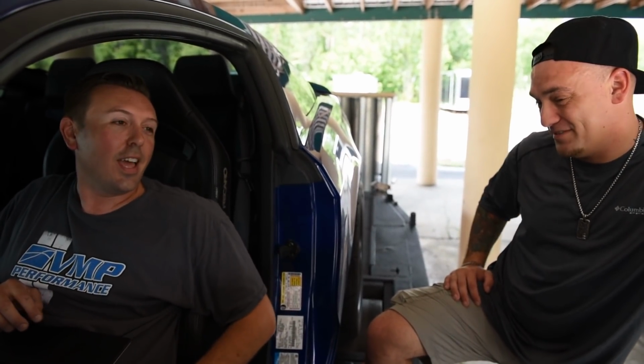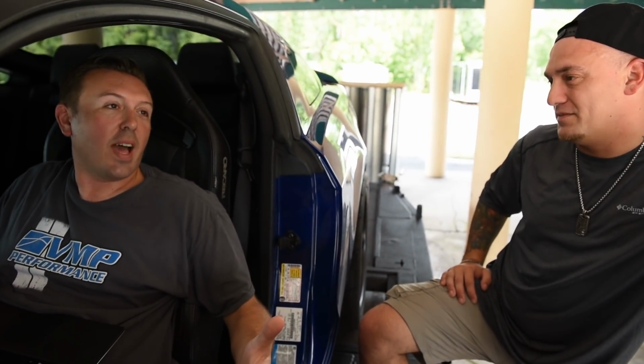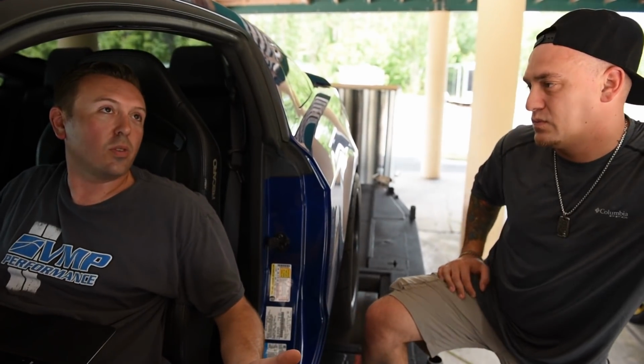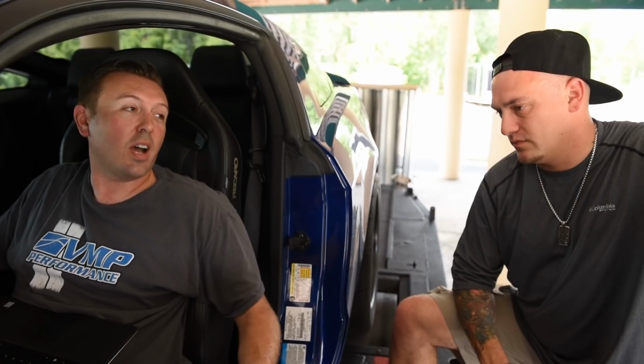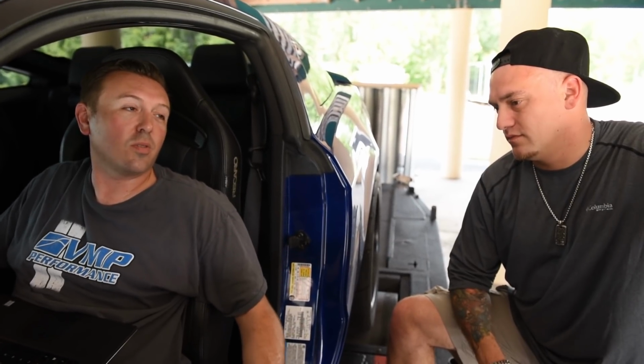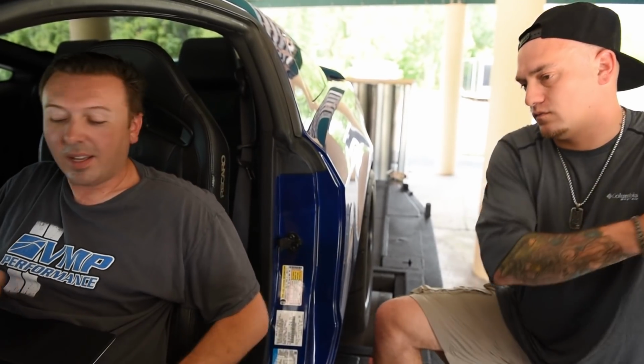Unfortunately, Justin, you're a little bit jaded as far as other GT500 owners. The one thing to be said about all this is that we developed that fear of making too much horsepower when the cars first came out, which is like 6-7 years ago now. We know so much more now. The superchargers are more efficient, the tuning's more efficient. We've got fuel additives like BOOSTane, we've got E85.